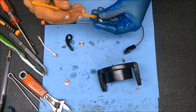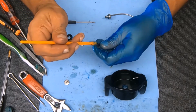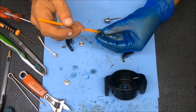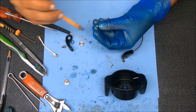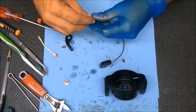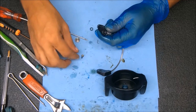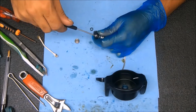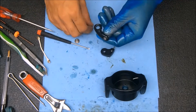Same sort of deal will be for the line roller. Where those bearings will sit is where I'll add some grease. Now mind you, I did clean these things off already. Drop that in, just like that. I'll hold this. You don't need to snug it down yet, just get it slightly tightened. The runner is good. Let's take that washer back in.